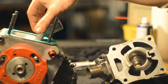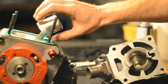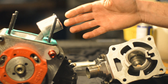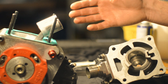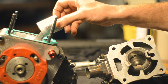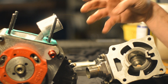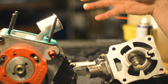It seems to be fine. There was a lot of grey stuff in the oil - probably aluminium - but there's a pretty even wear pattern around the piston. I think it's down to my shitty honing job, and the bore is probably not perfectly round. Compression is the same as before testing - it's showing 75 psi on the gauge, though that's not correct, the gauge isn't accurate. It usually reads around 100 psi for a comparable 50cc engine, so it seems a bit low.